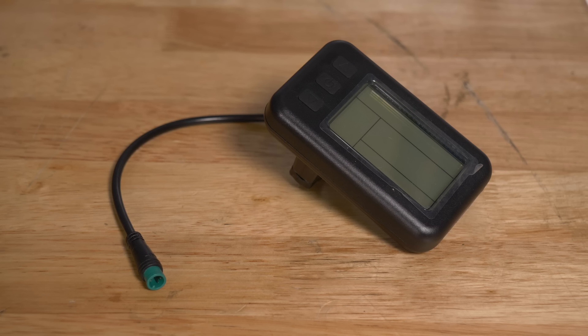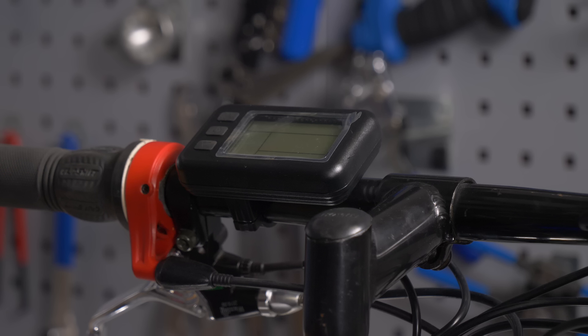The upgrade doesn't cost much. You can get LCD screens, pedal assist upgrades — it usually comes in the kit. These kits start from maybe £150 for a front hub drive, but you've also got to get the battery on top of that, which is from £200 upwards — it usually about doubles the price of the kit. Make sure you're getting the right size battery in watt-hours and amps to suit the kit. If you're looking for a straightforward system for fire roads or commuting to work, a front hub drive is a great option.